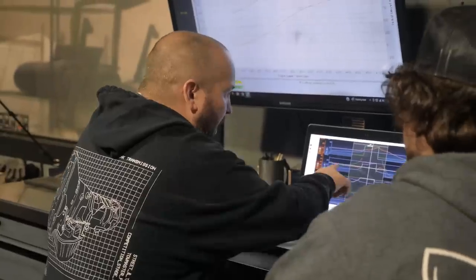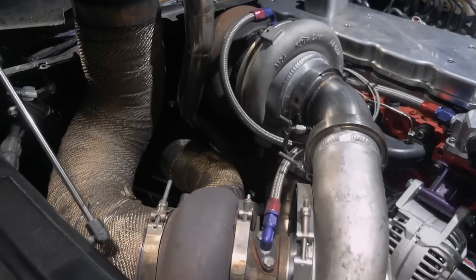We got Bubby Payne's truck back on the dyno. This truck had come to us with — he had just done a fresh build and was having some problems. He had redone the wiring harness and there were a couple things that got messed up. He had to de-pin the injector harness and I think injectors one and two got flip-flopped, which was why it was not running correctly. The staging limiter was wired into the wrong pin as well. Then on the first pull, it chucked the freeze plugs out of one CP3, which was kind of a freak deal. DDP sent us a new pump — it's got two DDP 12 mils and DDP 400% overs. We're suspecting maybe a piece of contamination got into one of the injectors. We just got the injectors back from DDP and it's finally running right the way it's supposed to. So now we're going to run it through its paces on the dyno and see what kind of power we can make today.